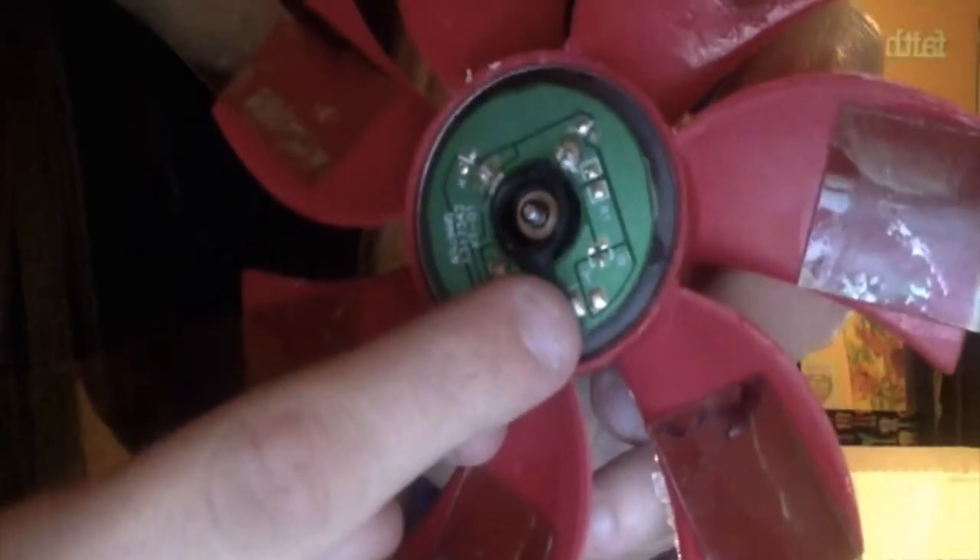You have your three wires right here. You have your positive, your negative, and then your Y wire. You will have your red wire on your positive, black on your negative, and then on your Y you will normally have a white wire. What you will do with that wire is connect it to the coil legs on the bottom. This is being connected to a coil leg, and then your negative one will come over here, and your Y will come over here.